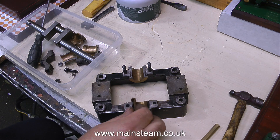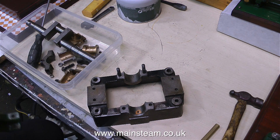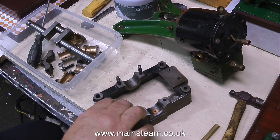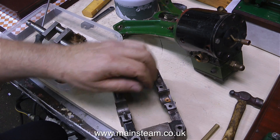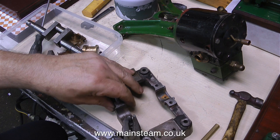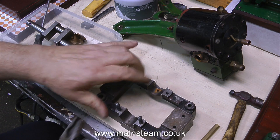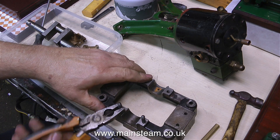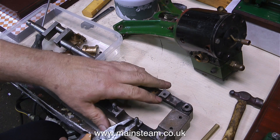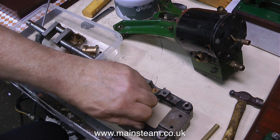In this clip, I'm removing the top part of the engine and what's left of the bearings. Like the big end brasses, the bearings have also been bored out to a stupid size, so they're going in the scrap bin as well. I'm taking all parts of this engine right back to the individual components - that's the only way I can do it, I need to see what I've actually bought here. In this clip, I'm removing the studs that hold the bearing top caps in place. I'm using pliers on the studs because I'm going to be replacing all these, so it's not important if they get scratched by the pliers.